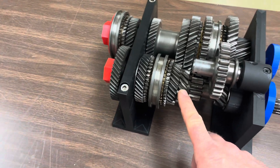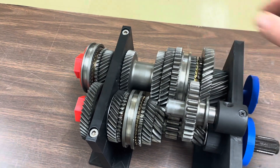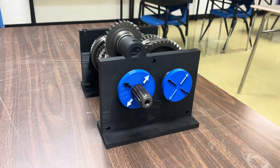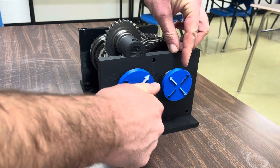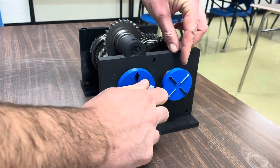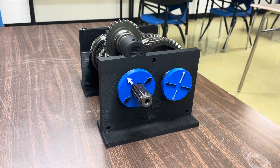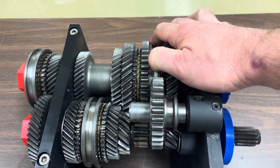Second gear would be this next bigger gear from the smallest one, and again a slightly smaller gear than the biggest one. I'm going to shift that over into second gear. I'm going to reference this black line straight up right here with this white line. The black line has gone around once, twice, and then just a little bit. So you can see that my first gear ratio was three point something to one, and now my second gear ratio is going to be two point something to one. We could get the exact numbers by counting the number of teeth, but we're not going to do that unless you have a purpose to do so.